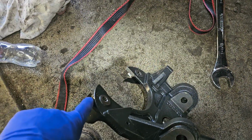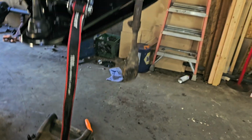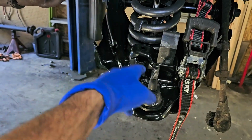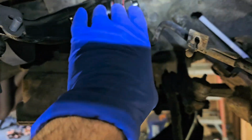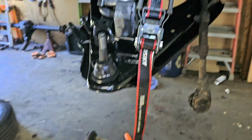Now, the brake caliper mounting goes to the back. This is for the steering. Same deal. Steering, brake caliper will fit right here. Bottom hole here, top hole here. So we're going to go ahead and set this all up, and I had loosened all the control arms so they can move a little more freely as we do this.